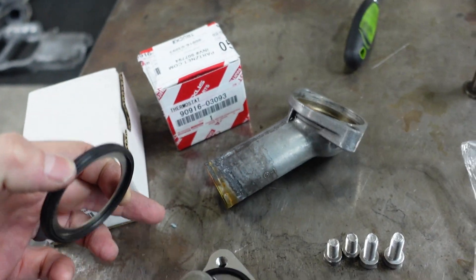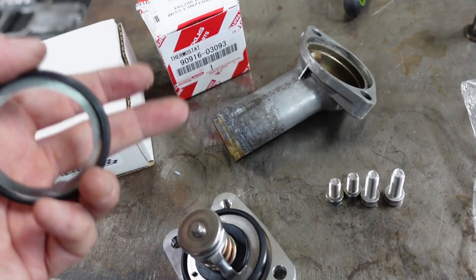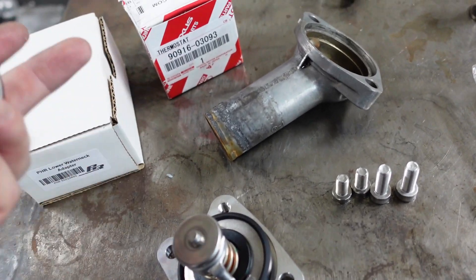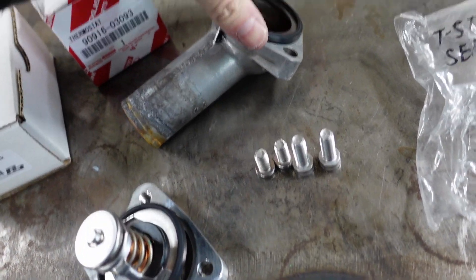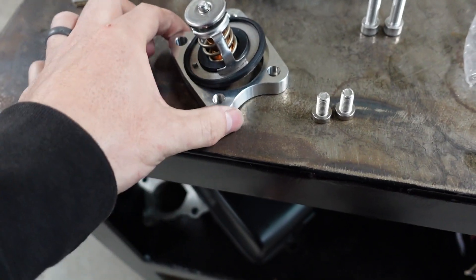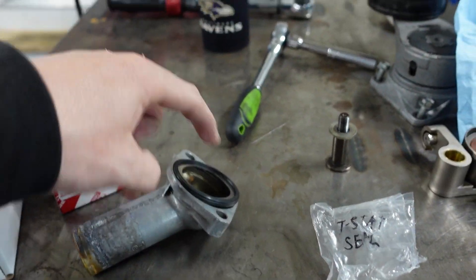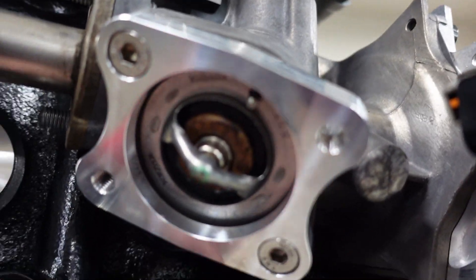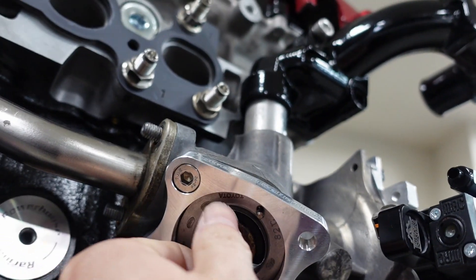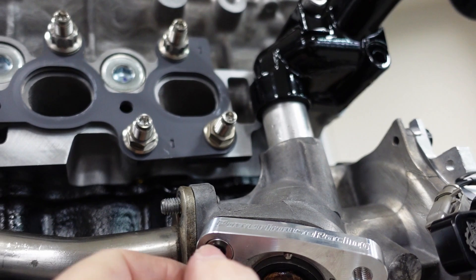It also comes with this little ring that goes inside your factory thermostat neck. I have an NA one — I wish I had a twin turbo one since it's slightly longer and comes down better for a hose. PHR also sells a coolant hose designed for it, or you can cut down a factory one, which I did for years. I want to run a PHR one because it looks cooler. I'm not doing AN fittings on this car. So this pops in here, and the short stubby bolts go into these recessed holes, which then bolt into the main piece.